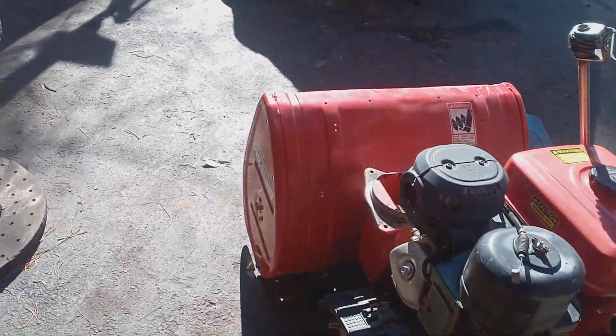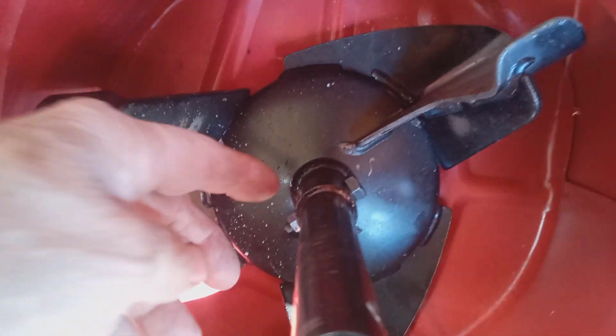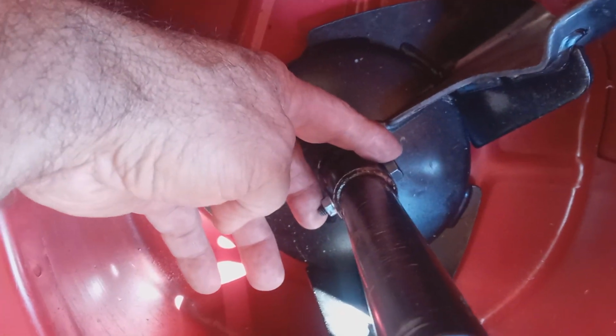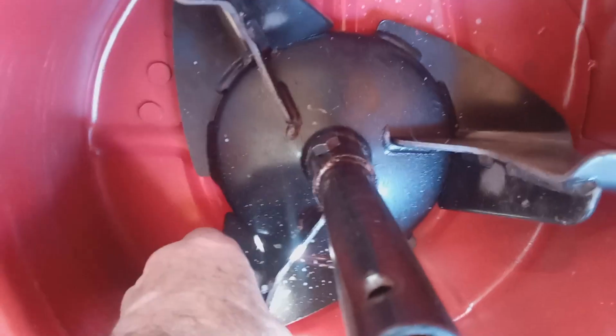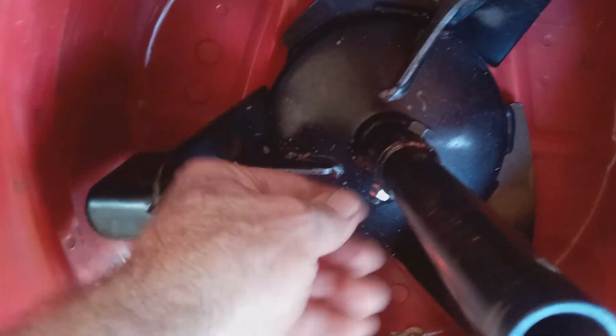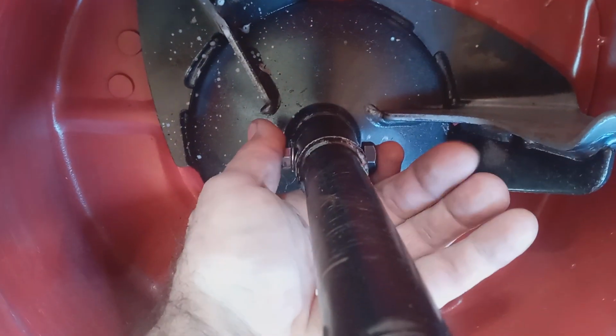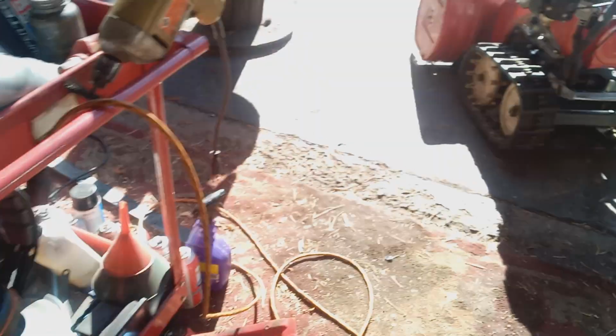All right, let's move up the line a little bit. You've already checked the shear pins and everything seems to be okay. Oh, before I forget, sometimes you can look in here and see the shear pin in there, but if the shear pin's broken inside, it's not going to spin. That happens sometimes. The head of the pin might fall out, and then you see the nut and you see this part of the pin, and you say, oh, I'm okay. Try to clean out the snow and ice so you can see both sides, okay? Because I've seen that. People have brought the machines over here and part of the pin's missing, and that's why the impeller wasn't turning.